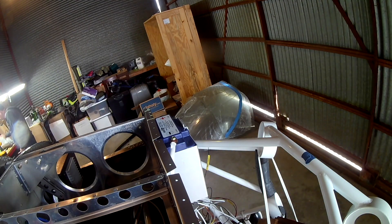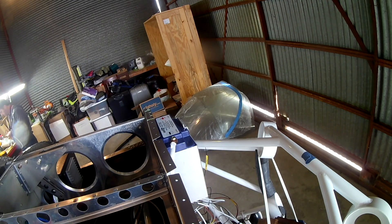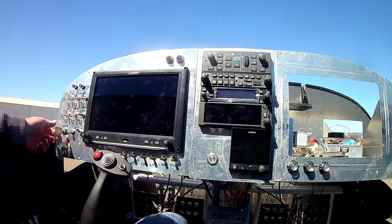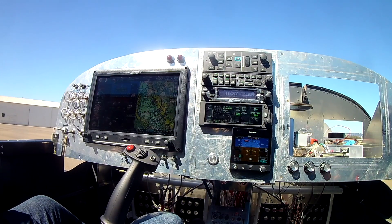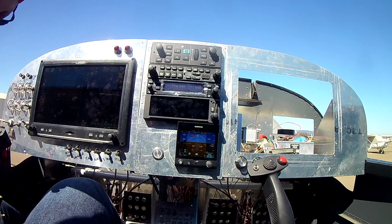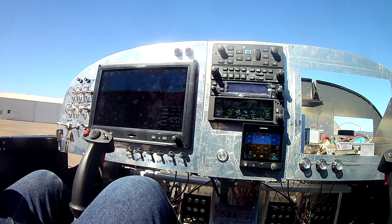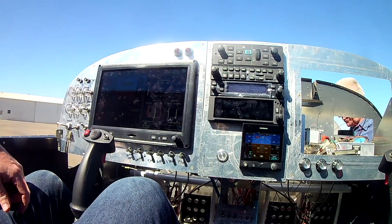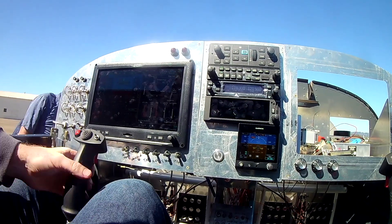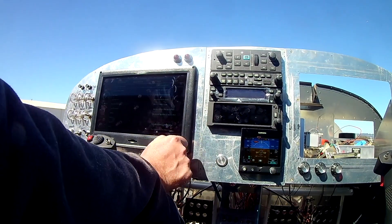Right here, as I'm about to pull this plane out, I figured it out. If you want to have your weather and traffic, you have to go through the settings and fill out everything. There are no transponder settings you really need to worry about — you need your OAT hooked up and pressure altitude sent from somewhere encoded, which I get from the ADAHRS unit on the back of the G3X. The one I missed is the airplane setup settings that ask for the length, width, height, and stall speed of your aircraft. I always intended to set it up, so when I was bored I finally did — and there it is: traffic. Now it's all working, no thanks to my own stubbornness and stupidity.